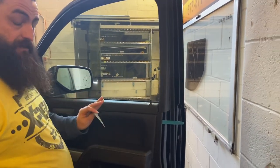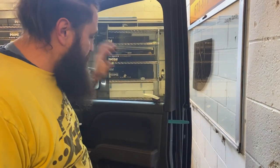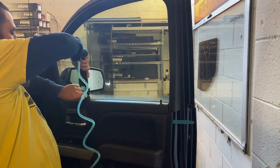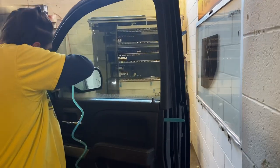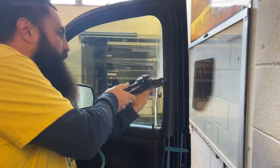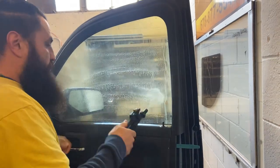So this is the final prep. I'm going to take my little custom easy reach that I've bent in half and slide it here. The first thing I'm going to do is flush out this bottom seal. What that does is help push down any contamination that you couldn't squeegee. And not only am I going to flush this, I'm going to flush out these edges. Flushing does a couple things — it flushes out any contamination, but it also lubricates it and gets it ready for install.